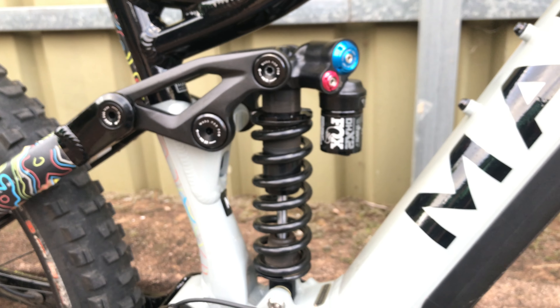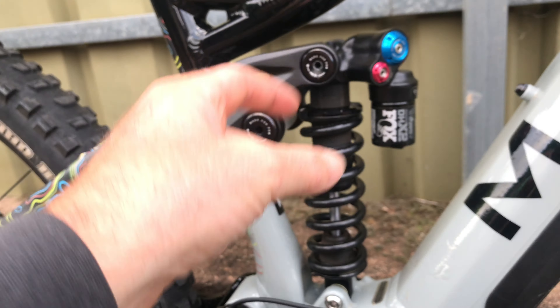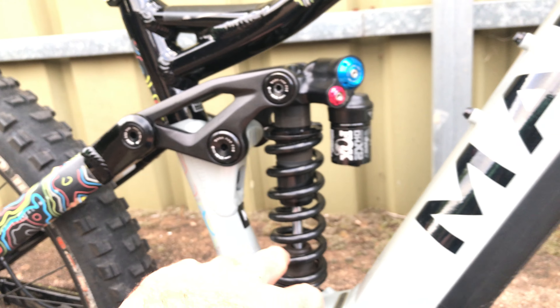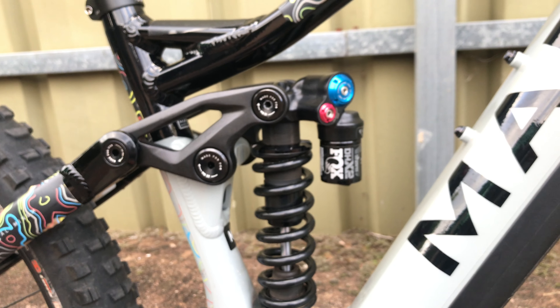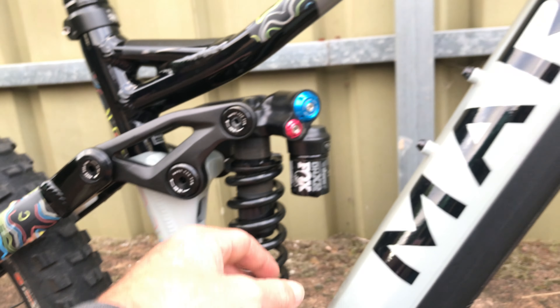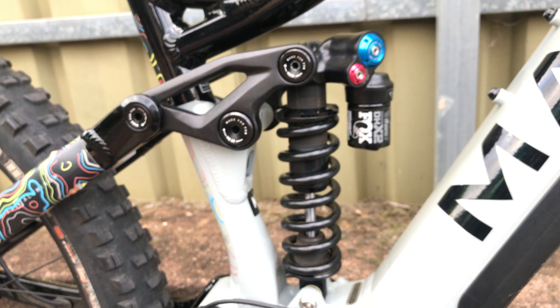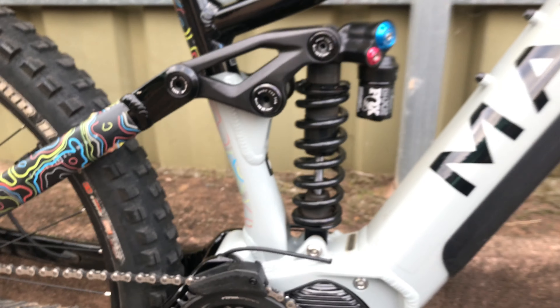Big range of compression, about 22 clicks. I'm on a 400 spring — feels right for me. I haven't measured the sag, but when I picked it up it was on a 450 spring and I was at 16 mil of sag. I want 19.5 on this thing, so a full spring rate down should have me around the 19 mil mark. Feels great on the road, exactly where it needs to be.